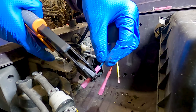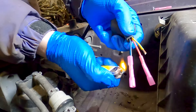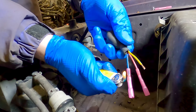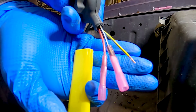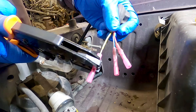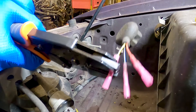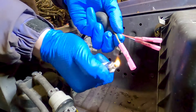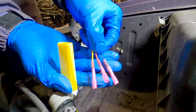The process is the same for each wire end. Insert a butt connector into the crimping tool and hold it in place. Slide the wire in until the insulation meets the end of the metal and the bare wire is in the middle of the butt connector. Crimp it down — make sure that you've ratcheted all the way and the tool should automatically release. Do a tug test for every wire you crimp. It's very important because loose wires could cause more resistance in the future and you might end up back here fixing the same issue again. Heat shrink the finished end of every connector and there you have it — the pigtail is ready to be spliced into the main harness.